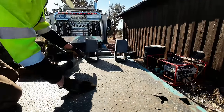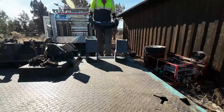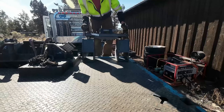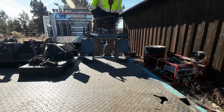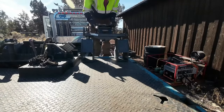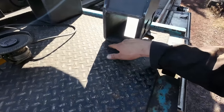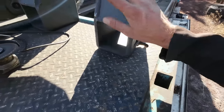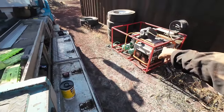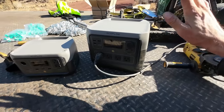My thought is I put that right there and that right there, and I make a mount on the bed that mounts them there. Then this can drop into the top, the fifth wheel plate can pin back to the top where it belongs, and this whole setup can store right there. So we've got these sitting where they're going to need to sit, I traced around them with a marker, and we're going to grind down to bare metal and weld our tabs on to hold these in place.